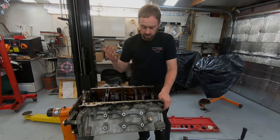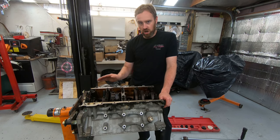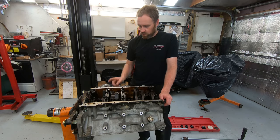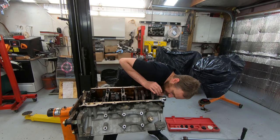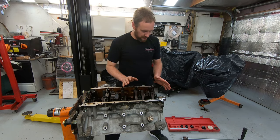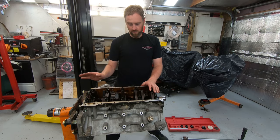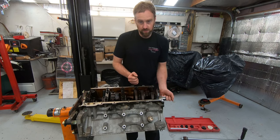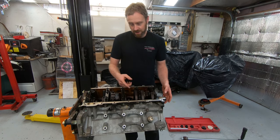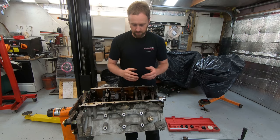The first thing you need to do is determine whether you need new bearings. The factory GM bearings are just horrible junk — a terrible design, which I'll explain in a bit. This was a remanufactured motor but it still has the OEM-style bearings, which are very crude. When I pulled the camshaft out I knew the bearings were bad right away — I had to put a little force into it because it had worn grooves into the bearings.